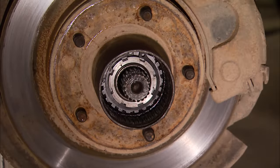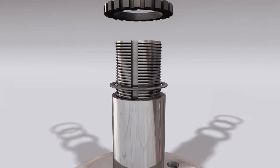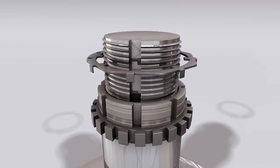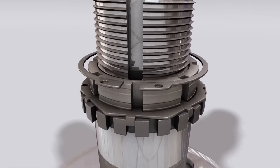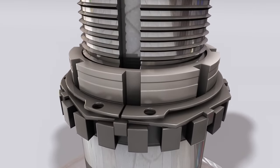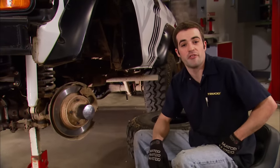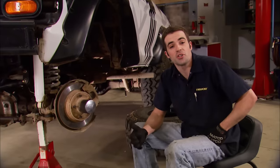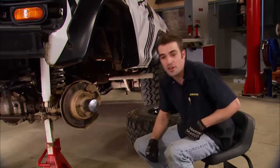Here's how their X-Lock system works: first, a thrust washer gets installed, followed by a notched washer, and then the grooved spindle nut. Once it's tight, the lock and retainer gets installed, locking the spindle nut to the notched washer. Finally, a snap ring holds it all together. The best part of a mechanical locking fastener is it not only prevents the joint failure itself, but it also prevents any collateral damage from that failure.